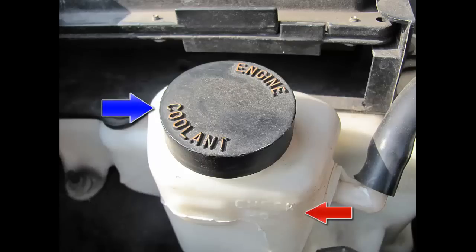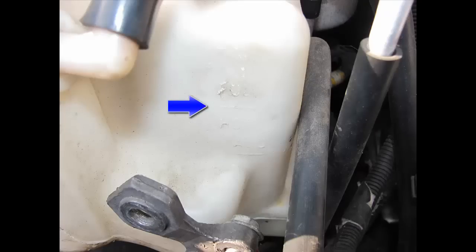The Chevy Blazer is a little different. If you notice by the red arrow, it says 'Check Hot.' What that means is: after you've topped your coolant off while the vehicle is cold and put the cap back on, bring the vehicle up to temperature, let it warm up, and then check your engine coolant — highlighted by the blue arrow — by removing that reservoir cap. Do not check the coolant level in the radiator while hot; you're only checking the reservoir level while hot. The blue arrow shows a little line that says 'Full Hot' — that's how you do a Chevy Blazer coolant level check.